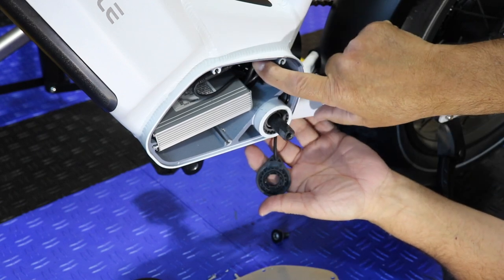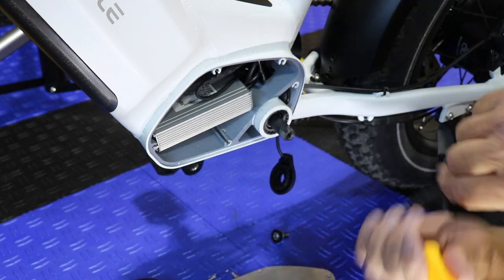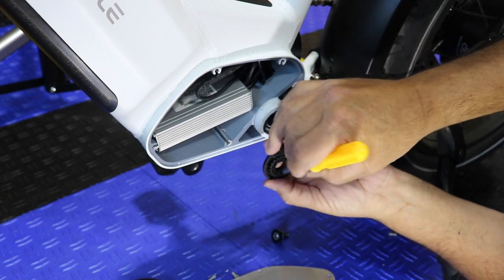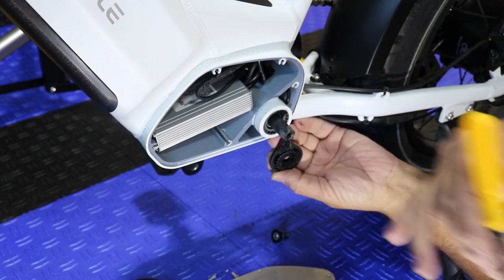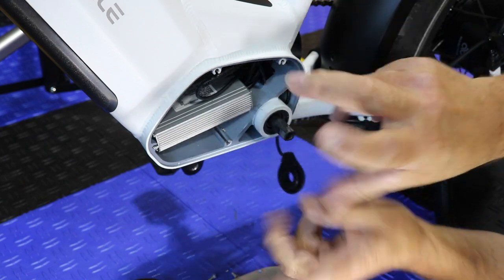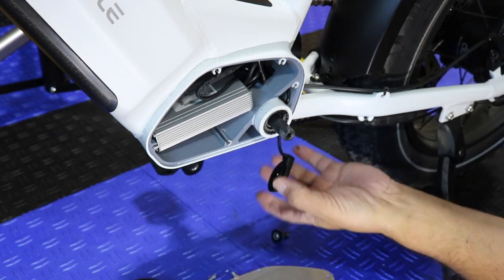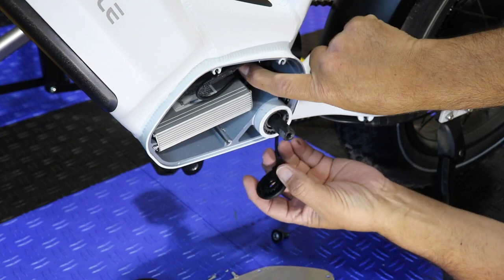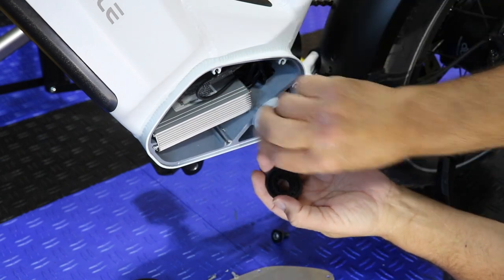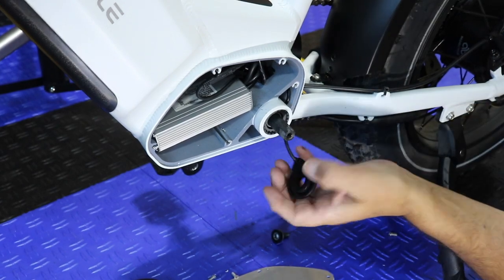Here's how I would do it if I were you — certainly do not pull all this out. It was very, very easy. All you've got to do is reach up in here, pop one of the scallops out, and you'll feel it pop. Then press the new one in — the new one's got three little grippers and you just press it back into place, and it works. That beats fighting all of this. Just take the crank off, take the inside of the sensor out, put the new inside of the sensor in, and plop it back on — done. Truly probably a 10-minute job versus what's going to be a half hour.